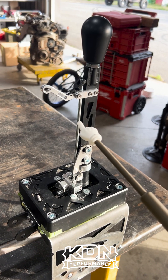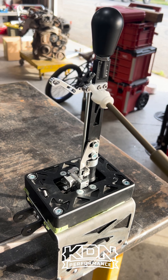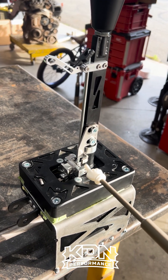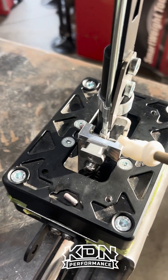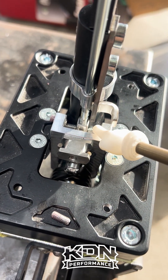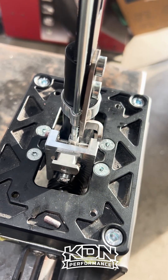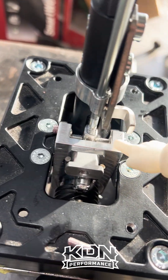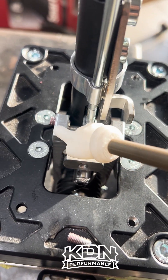Here's the B front-wheel drive shifter. This lever right here is made to disengage the 2/3 lockout, which is this block, and the fifth and reverse lockout. The way you adjust this is by screwing in or out these four set screws.